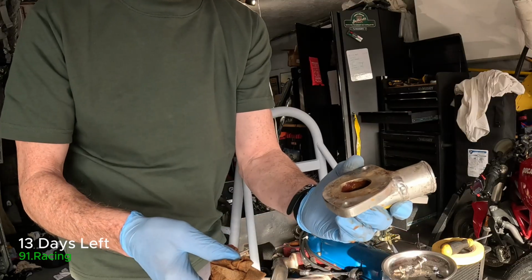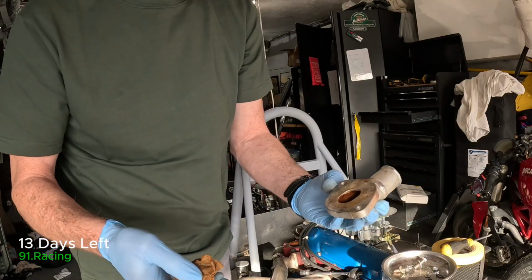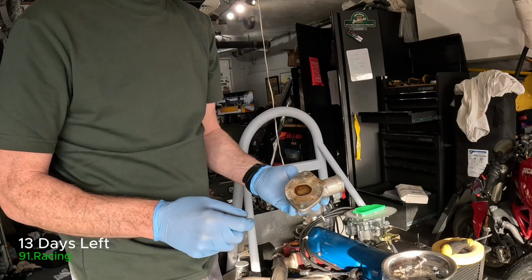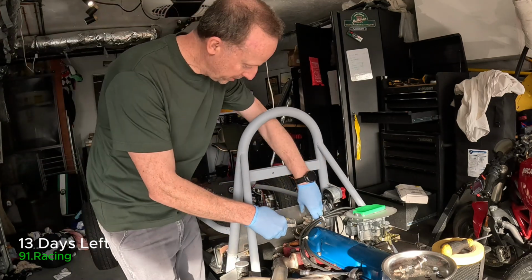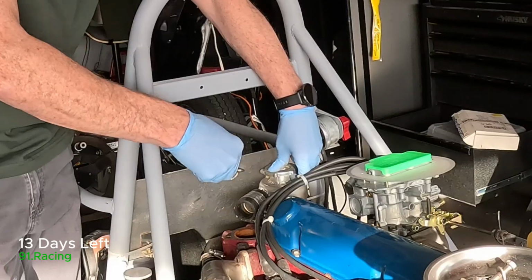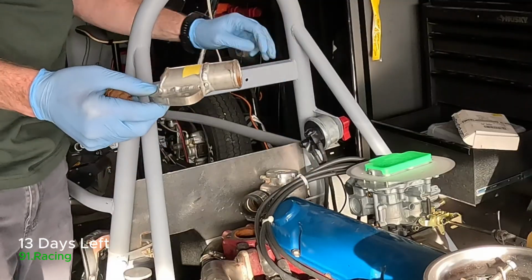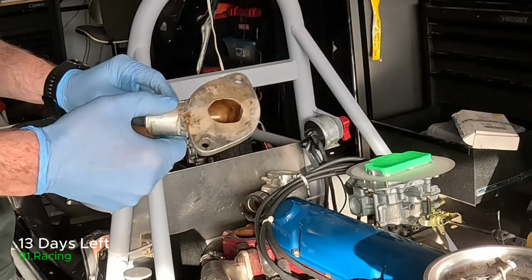So it's pretty wet, no big surprise. So the engine's trying to pump water through there, and obviously it is blocked. I didn't put it in there, but it's super interesting that it was in there. I'm kind of glad we found it now. So we might have solved our overheating problem. It's almost guaranteed to be one of our problems solved. But while I'm here, I'll show you what else I'm doing. So the issue here is that this tank is really close to this firewall, and we can't get the expansion tank hose on there to flow into the expansion tank. So I've got a different one of these, which is at an angle. I'm hoping that will help things out. So anyway, a little bit of success.